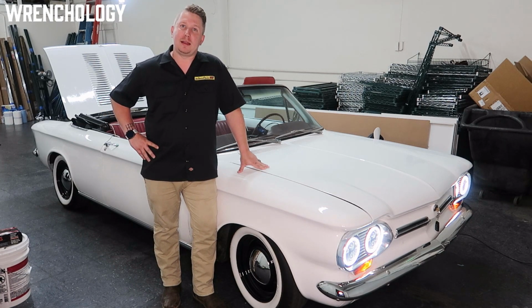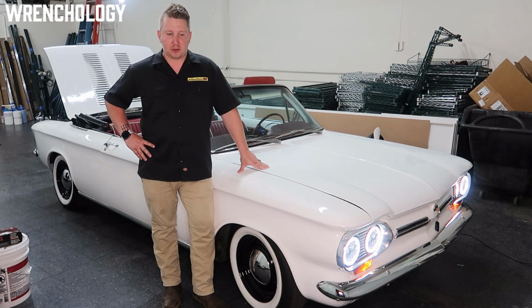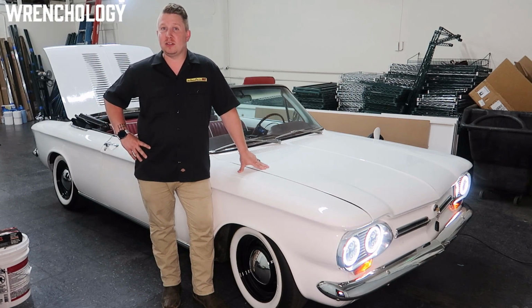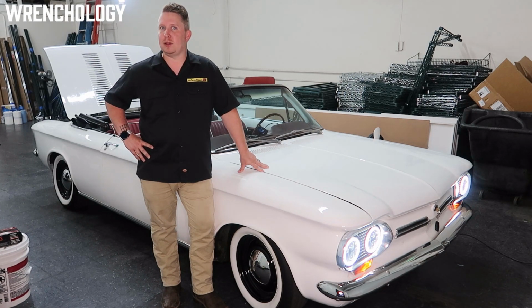That's nominal, where they are the most efficient within the 18650 cell design from Tesla. So that's pretty critical for lithium-ion cycle life. It's a really great power density battery, but it's also very finicky for temperature. I'm sure you've heard that EVs are not great in colder temperatures and things like that.